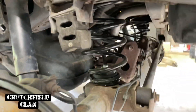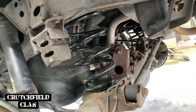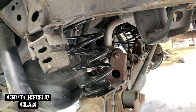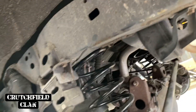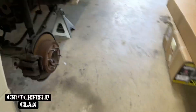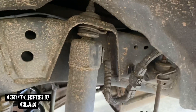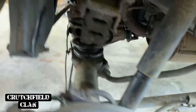We're back in here, and I told y'all I've already done an airbag delete on this one - I've got another video showing you how to do an airbag delete and how to put an Eibach rear end lift in. This is going to be extremely similar. I can probably use that puck and then I'll have to change the upper. These nuts on the top of the shock just will not twist - it turns the whole shock. So cutting that nut off, and then I'm popping the 19mm down there on both of them - that'll let my axle pivot.